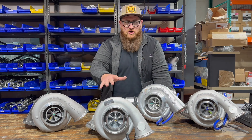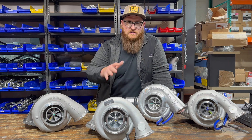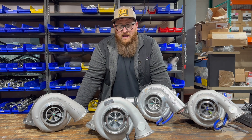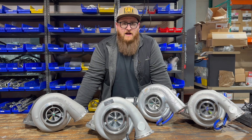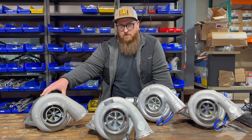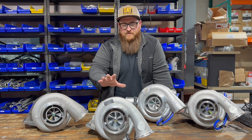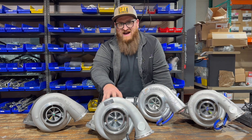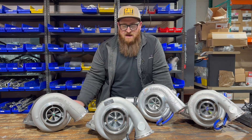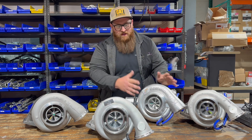On the turbine side, we're using the smaller turbine you'd find in the GT42, because it's extremely efficient — Garrett's been using the GT42 turbine for a very long time, it's well designed and very robust. That smaller turbine versus the larger one means this will actually spool up, whereas your S400 would normally be laggy. For the exhaust housing we're using a 1.15 AR, which is really tight — but that's why we put a wastegate on the setup, so you get quick spool like a K31.